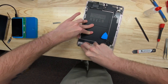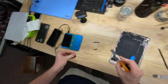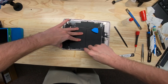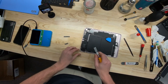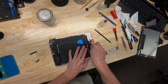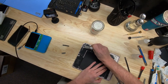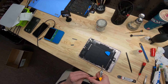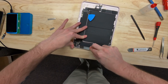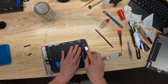Next up we're going to clean and prep the frame. We'll use our razor blade tool to get up all the remaining adhesive and glass on the side of the frame and toss that in the trash. These frames are very narrow, so you definitely want to clean and then prep the frame with some Primer 94 to ensure a good bond and that the screen does not lift. On these iPads, make sure you're replacing with a premium quality screen — aftermarket screens on any iPad assembly tend to be too thick, sit poorly, have off bezels and color. This model it's not much more expensive to get a refurbished display and keep an original Apple panel.